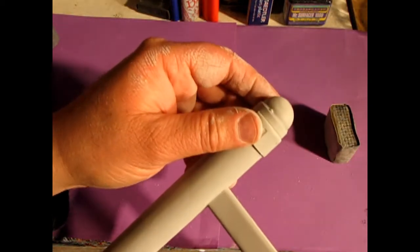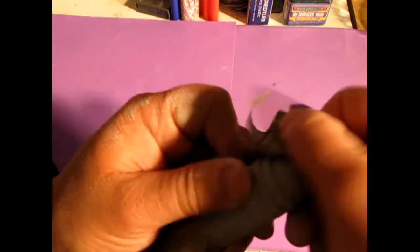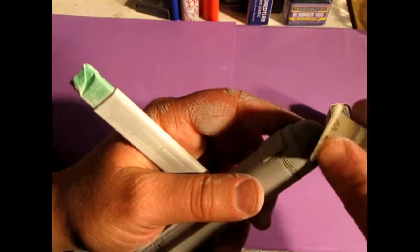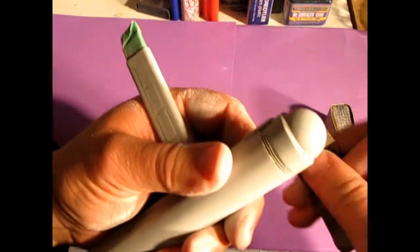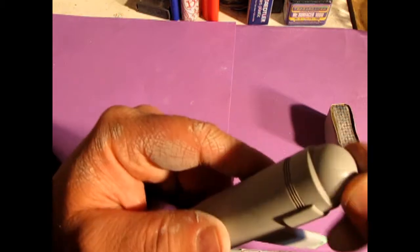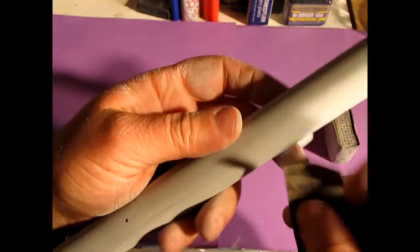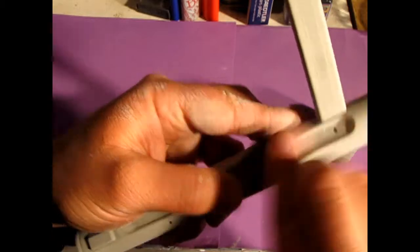Well, I'm going to take the 600 on the front of that. But between 400 and 600, it gets a pretty good grip, or cuts a pretty nice tooth on there for the paint to adhere to for the next coat without it being too smooth. You can go smoother if you prefer. It's all up to your taste. You can experiment going 800, 1000 grade, 1500 grade. Just depends on how smooth and how much you want to sand. I mean, that feels pretty smooth there. But on the microscopic surface, remember this has still got a bit of a tooth to it that we can't see. But the paint will know that it's there.